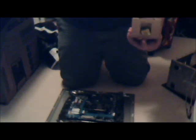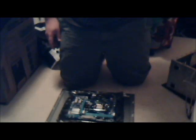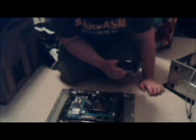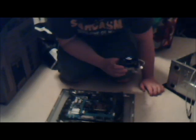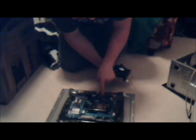Next, you're going to take out this. This is really loose in there. Probably not a good idea. The cover. But set it over here for right now. Okay, so this is the stock heatsink. Good enough for this build, guaranteed. What I like to do is first I get the wire out, and I like to see where the plug for the CPU cooler is on the motherboard. It will say CPU fan right here, on this motherboard, it's right there.